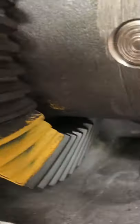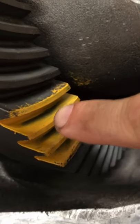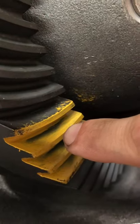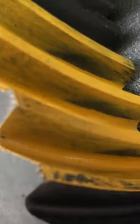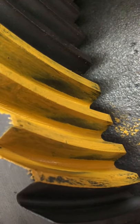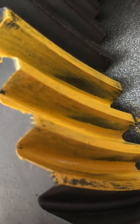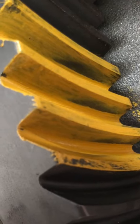When setting your wear pattern - this pattern actually looks pretty decent. It's a little bit spread out, which I would like it to be more centered, just in the middle there. But that one we can live with. I believe this is the coast side - as you can see it's too far towards the locker. So we need to take a little bit of shim away from the pinion, and that should even that out. Let's see what happens.